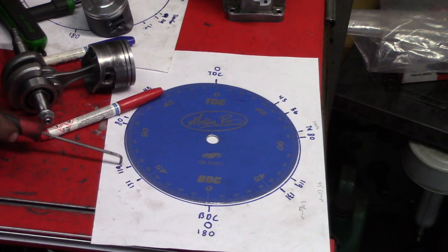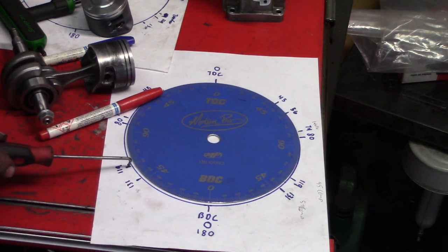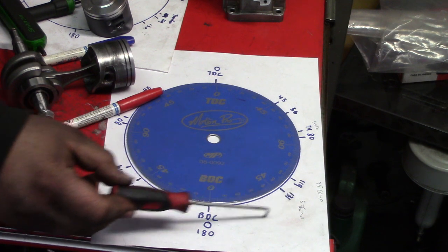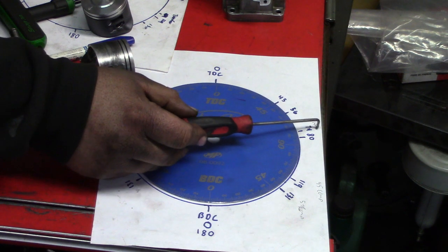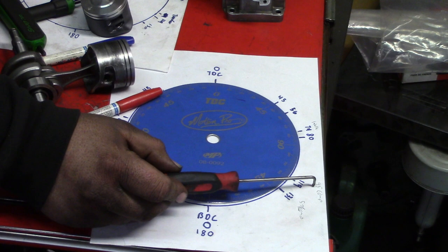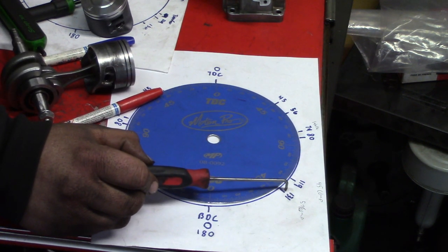What's actually happening here? If you run a short blowdown, you have a longer transfer duration — the longer those transfers are open, the less crankcase compression. With long blowdown, the shorter your duration. Your intake opens at 74 degrees. So we have 74 minus 119 equals 45 degrees of case compression — that's the OEM. But the aftermarket cylinder: 74 minus 131 equals 57 degrees of case compression.